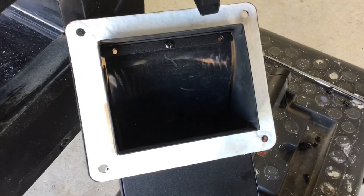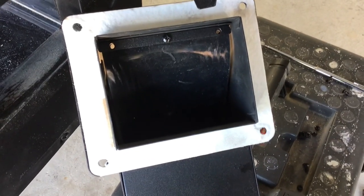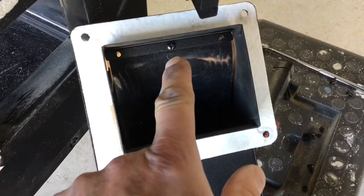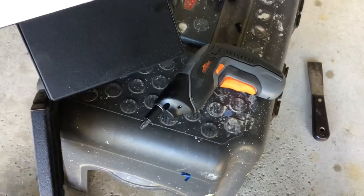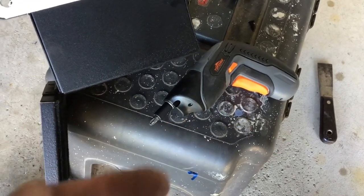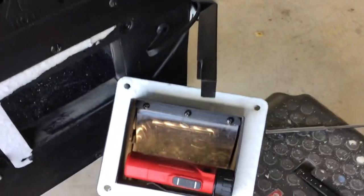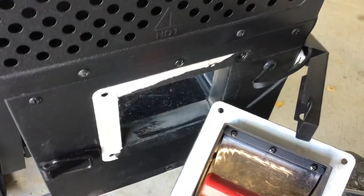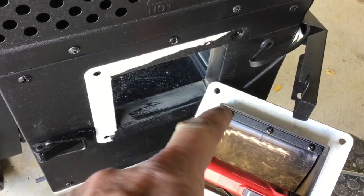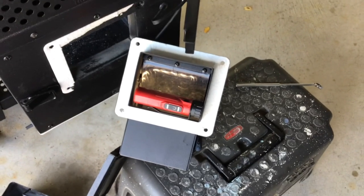You can't do all three nuts at once - you're not going to line up all three holes without something coming out. Make sure you've got a magnet to get them out of the box so you don't have to tip the whole thing over. I've got a light back there to help me see the holes. I did the middle one first and then the two outside ones. Using a finger for the nut and then the cordless to get it started - that seems to work. New flapper's on. Now I'm going to scrape that old gasket material off and put new gasket on, then put it back together and fire it up.